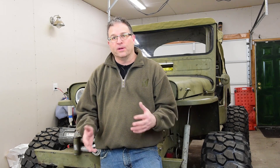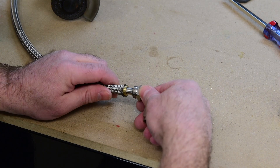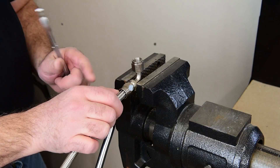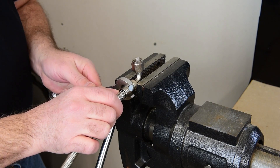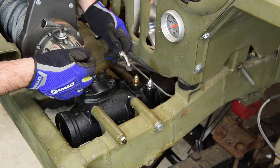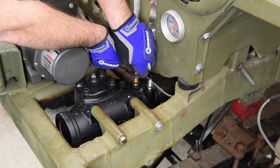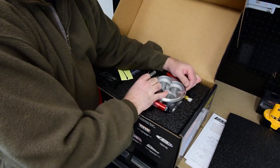The parts that I ordered came in and I was able to finish up the power steering. The power steering hoses didn't turn out exactly the way I thought — I planned to make two braided steel lines, but it turns out the lining in the hose is not big enough to go over the nipple for the low side on the back of the power steering pump. So for the low side, I'm just going to use the regular AutoZone replacement hose. That part's done.